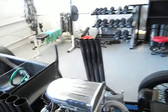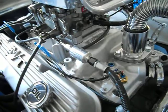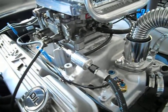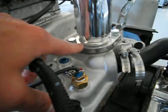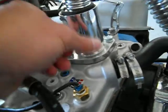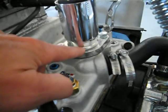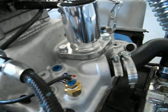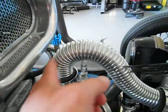So anyway, cut to the chase. I ordered myself a new Edelbrock Performer intake, which you can see here, which is designed differently than that old Streetmaster. I got that all torn apart and put on. Had to get a new thermostat housing here. This is actually a straight up and down. The old one I had was a billet one that turned and curved, but this actually helps seat the thermostat. And then I bought a Performance 160 degree thermostat, mounted it all in, and then I had to buy a new hose, so my new hose runs up now and into the thermostat.